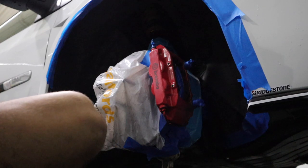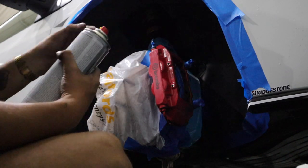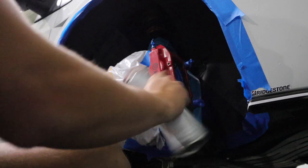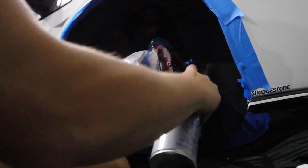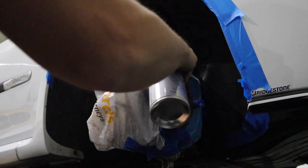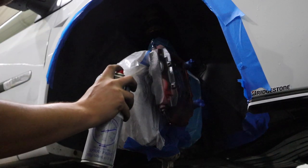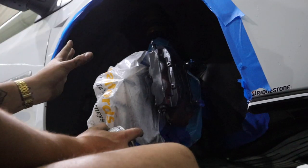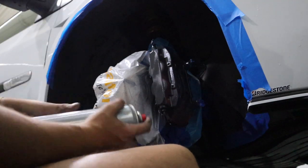So I have sanded it up a bit with some sandpaper — 2000 grit. Don't need to go crazy. This is the etch primer. We've got professional spray paint, U-Pol. Pretty good stuff. Hopefully it's going to do the job. I won't go too crazy for the first coat. I'm actually getting nice even coverage everywhere. I want to do a quick go over this, finish this up. Once the primer's all on and settled — probably two coats of it — just to make sure it's nice and filled up and looking good.